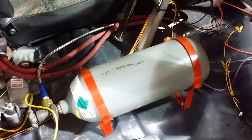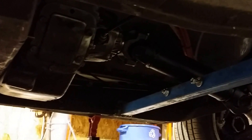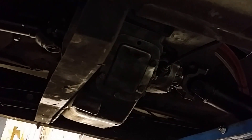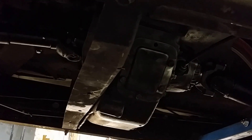For doing the Colorado Mile race, I started with it in overdrive. I run it direct drive and then have an overdrive that's actually made from an NP205 divorce transfer case. You can see it right there. From where the motor would be, the shaft comes back — I've got a drive shaft hoop there so if that first shaft goes, I don't lose my legs. The NP205 is turned around, so instead of being a two-to-one low range, I've got a 50% overdrive, which worked out really well for a $200 transfer case that I yanked the guts out of. Then a drive shaft goes back to the Ford nine-inch.